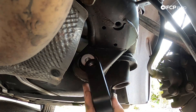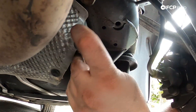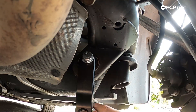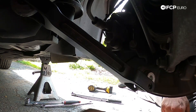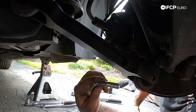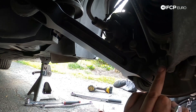First off, we're going to take the long side of the trailing arm and put it up here onto the subframe. Our installation is basically the reverse of how I removed it. I'm going to take the bolt and slide it in — the washer should be on the outside because this is a non-flange bolt, so you want the washer to support it. Since I'm using a genuine BMW lock nut, it already has a flange on it so I don't need a washer for it. Now we're going to take the short end and tap it up onto the bushing here on the wheel carrier. You might need the pry bar just to get some leverage and line up the bolt hole. It's worth noting that because the included bolts are longer, you can't maintain the original installation orientation of the bolts — flange bolts are not included like the factory bolt because there'd be no way to slide a flange bolt through the hole, as it would interfere with the lower control arm.